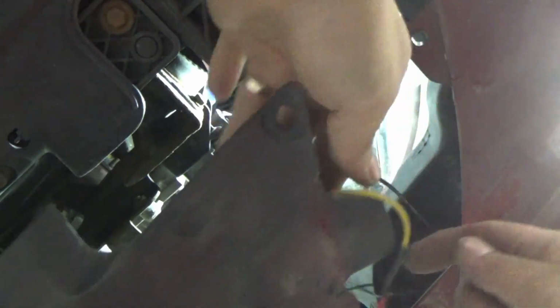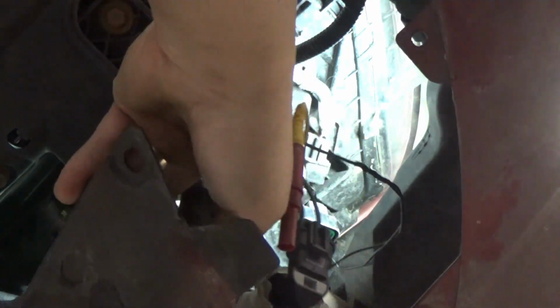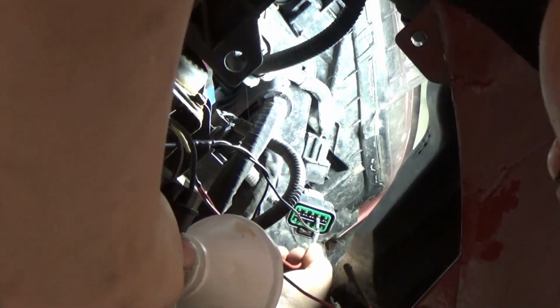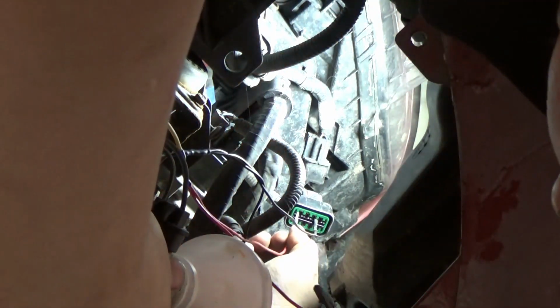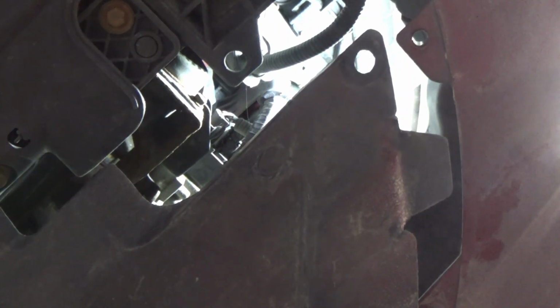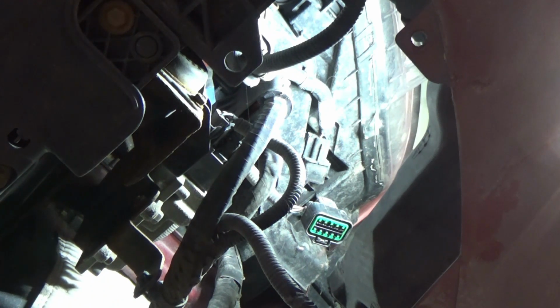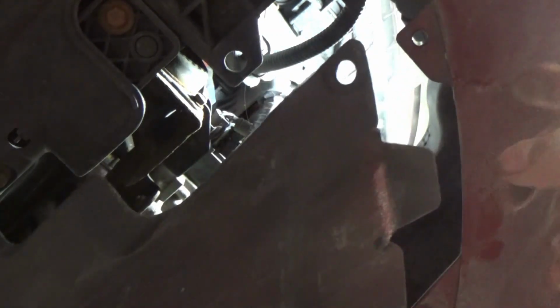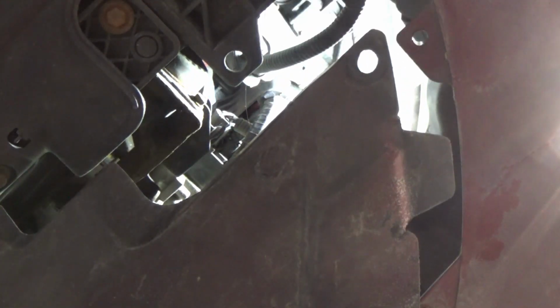Okay, got my headlamp there. I'm just gonna pop this. We're already ignition on there. I'm gonna put this guy here. Okay, as you can see there, our bulb turns on. Number 6. Number 5 and then number 6. Okay, so we have good power and ground. Now it's either that extension harness going to the active air flap, there's something going on there, but as we can see the damage on that flap itself, most likely this guy needs an active air flap. So I'm gonna call for the active air flap and we'll see from there.